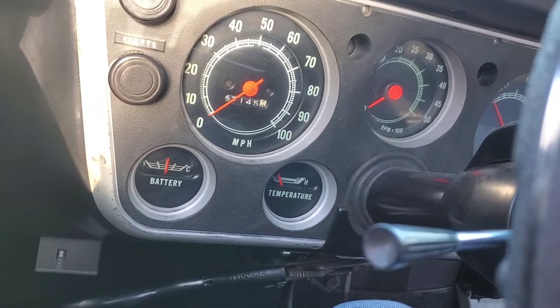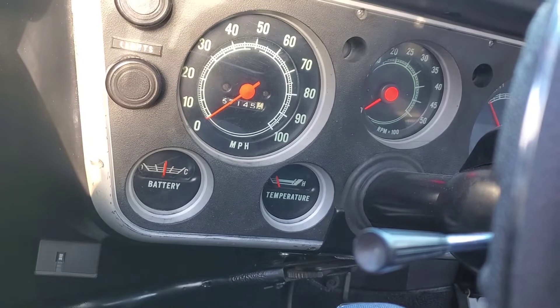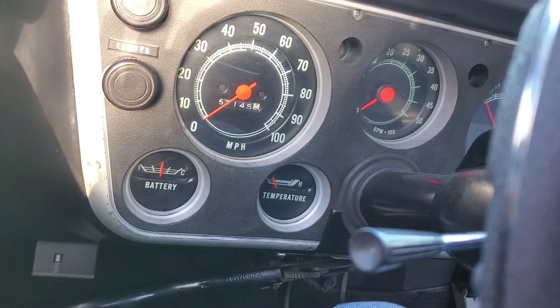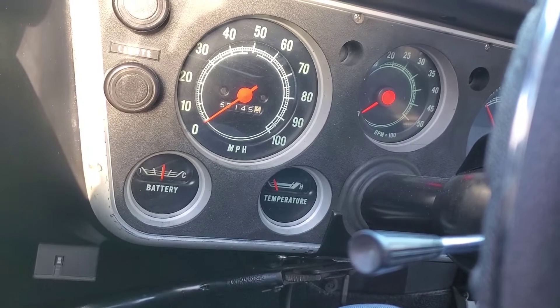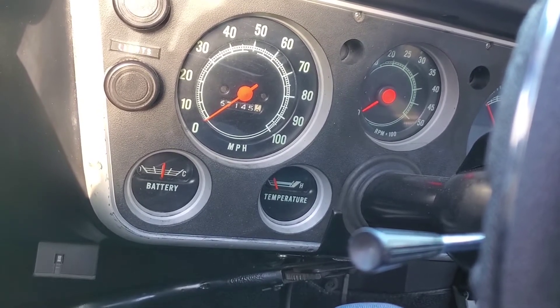The third control is a safety switch — a cruise control brake switch that has an extra set of contacts that are normally closed when the brake isn't applied, and that'll unlock the torque converter clutch if you press the brakes.